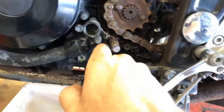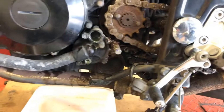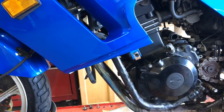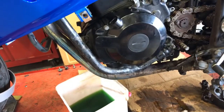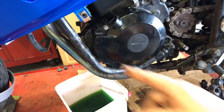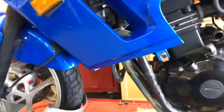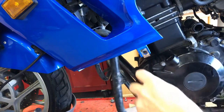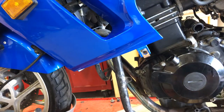I'm going to loosen up the four mount bolts for this water pump. As has happened many times in life, I've made another error, but that's okay — I'm working off memory here, so please read the manual. What you need to do is get up in here, disconnect the upper clamp, and there is a mount bolt right there on the case you need to take off. Let me get you in here a little bit better.